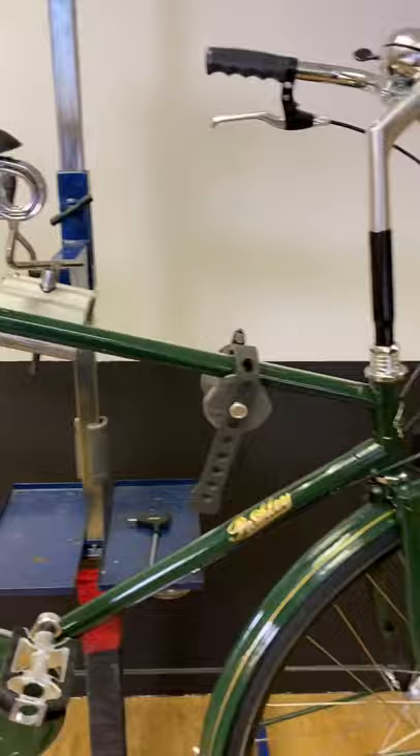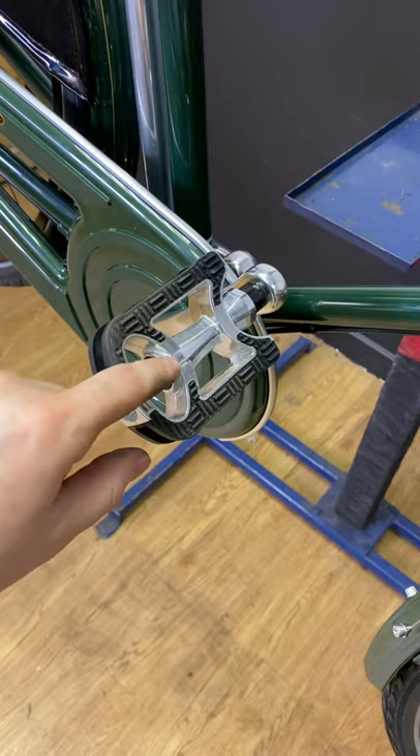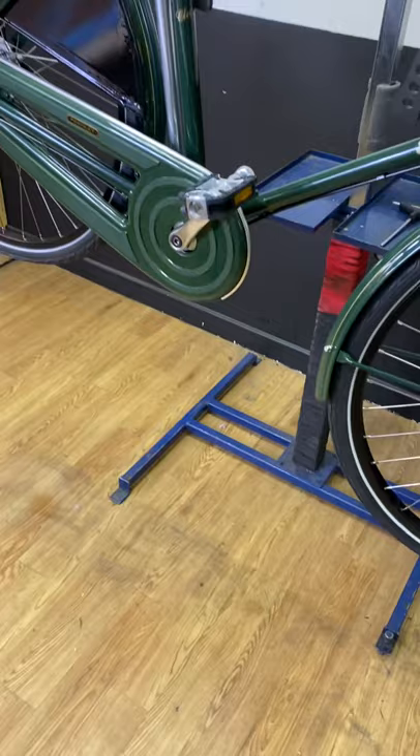Pedals — fairly basic pedals with it. Most bikes these days come with basic pedals. These are okay; they're made by VP, open bearings with no major seals, no sealed cartridge bearing inside. It's got rubber coating on the alloy, which will wear off over time and the pedals will become slippy. But it could be a year or so down the line before you'd need to replace them.